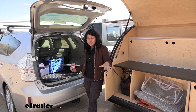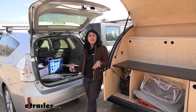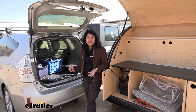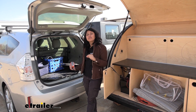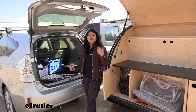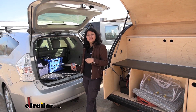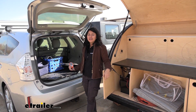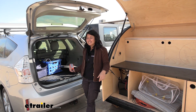Overall, I'm really happy with how this charger worked out. Yes, it moves slowly — it only pushes a maximum of 2 amps — but having the versatility to charge or maintain your camper battery in the middle of nowhere without an outlet is very valuable. You can plug it into your vehicle or a separate 12-volt battery. We charged it with a Prius today, which is a unique situation. Even when the source dropped below 12 volts, I just disconnected, started the car to recharge the 12-volt battery, then reconnected to the camper.